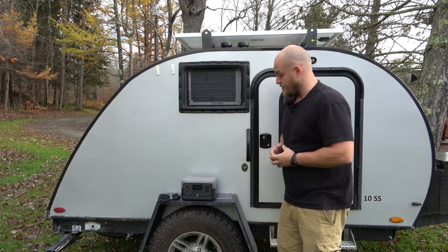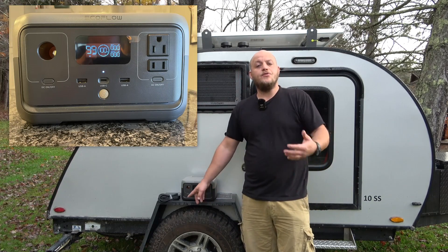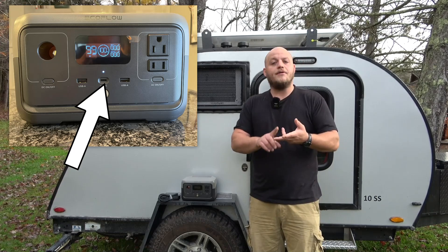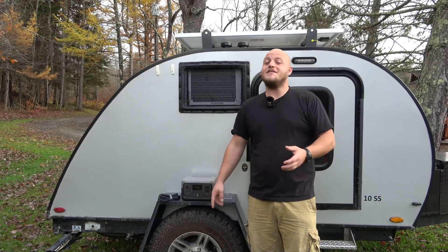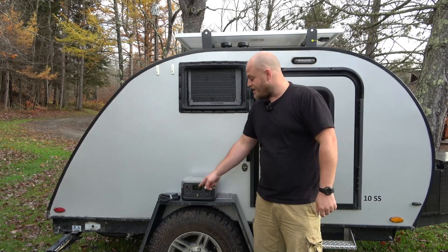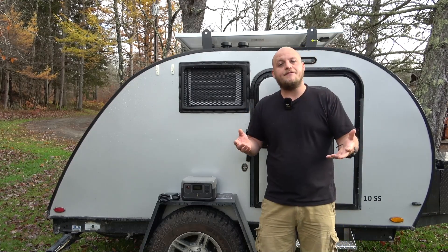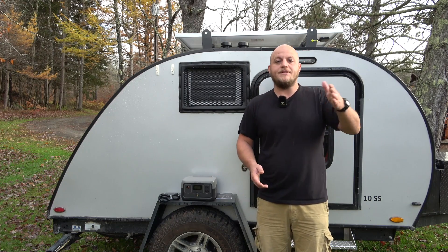On the center they give you two USB-A ports — the old style — and a 60-watt Power Delivery port. The PD port lets you plug laptops and tablets in directly for a fast charge. It's bi-directional, so you can take your laptop charger and charge the EcoFlow River 2 by plugging into that PD port.